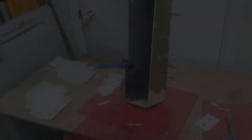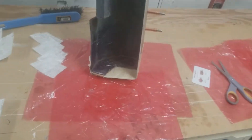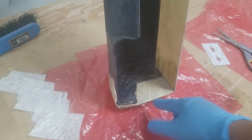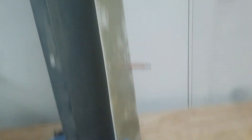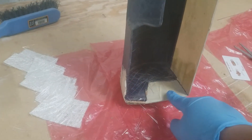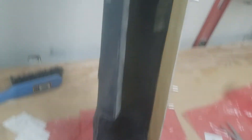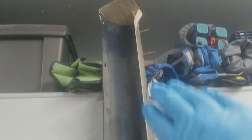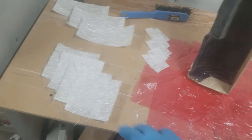I've now prepped my side skirt — I did the cardboard template on the outside, finished the straight piece, and went ahead and used some cleco pins to hold it on there so I could get that top angle I needed. The cardboard here I'm going to fiberglass in to finish up this edge, and up top I have the same thing in a slightly different shape to connect it to the top. I have all my pieces cut out and I'm going to fiberglass that.